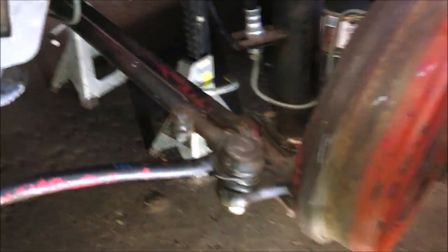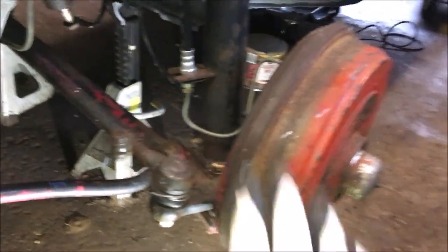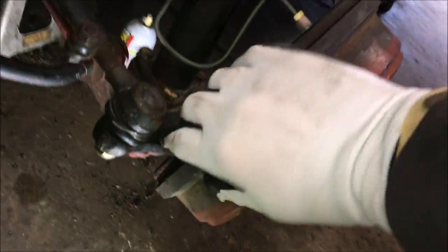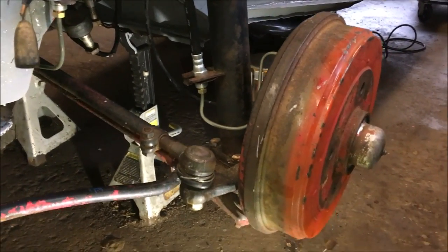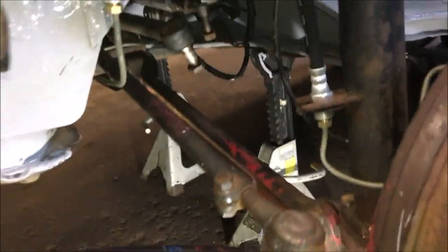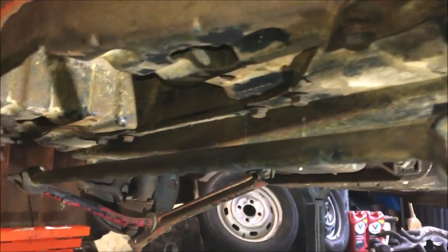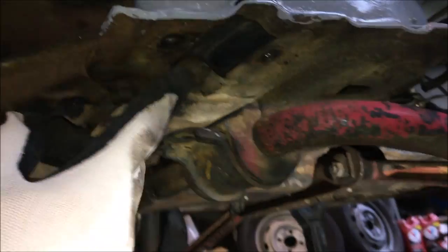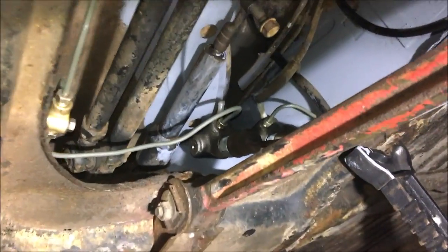As you remember before, I went ahead and did the new brake hoses and brake lines. I'm going to pop this brake line off so it's out of the way, pull these drums off, clean up these backing plates real good so I can respray them nice shiny black. I've got new inner and outer bearings on the way, new seals — nothing will go untouched there. That sway bar I'm just getting ready to pull off. I forgot to film it earlier but the only thing you missed is the two bolts holding the sway bar bushing up to the frame.